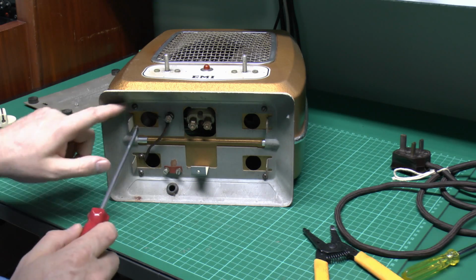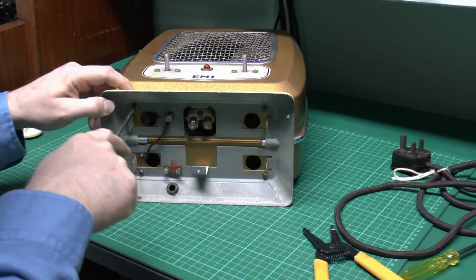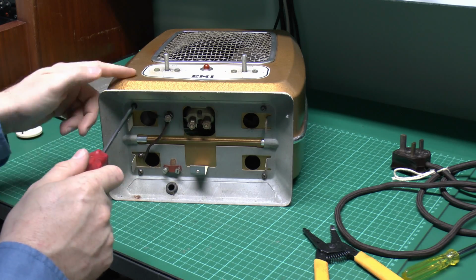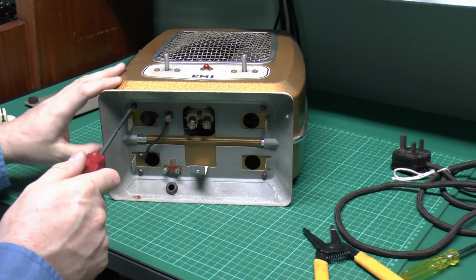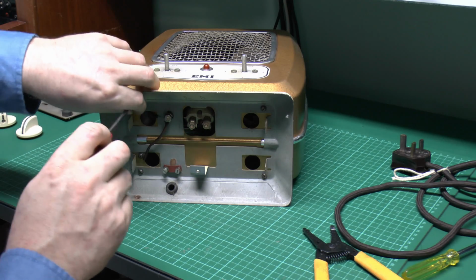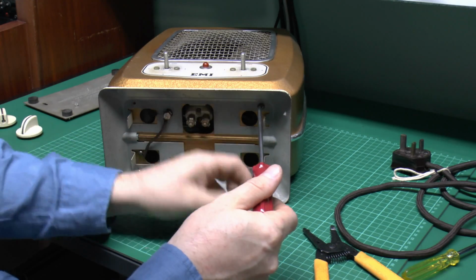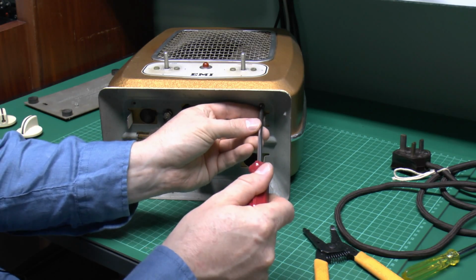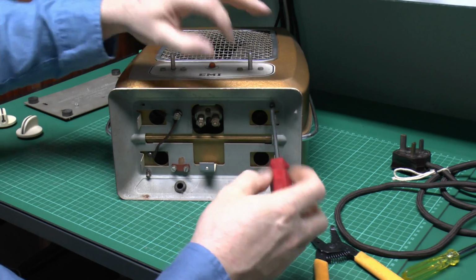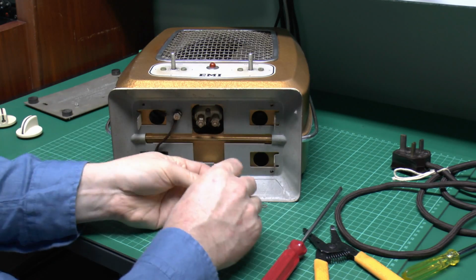Now for the rest of it, there's 4 screws under here which appear to contain the base onto the top. So we'll remove those because this is presumably in 2 halves here, and obviously this is joining them together, so it seems pretty inevitable that it's going to have to come off. And notice all these are slot-headed screws, so all assembled by hand. Cross-headed things are primarily only used for machine assembly because it's much easier for machinery to do those up.